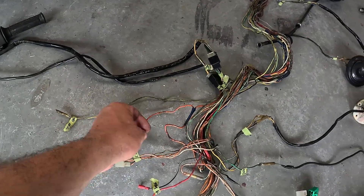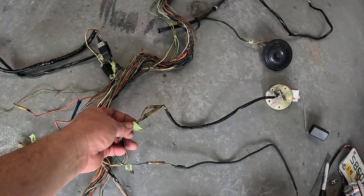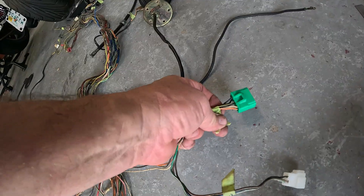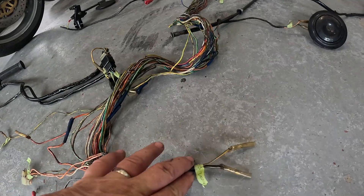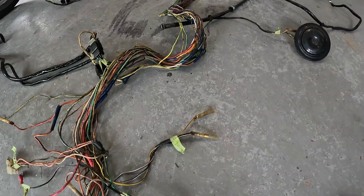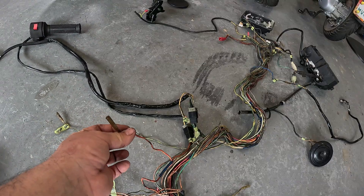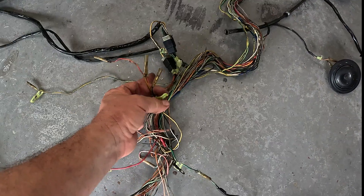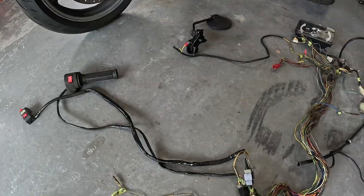As we go up the harness we're going to end up with wires we don't need — like the starter relay, coil wires, engine temperature sensor wire. But some stuff we're going to keep. For example, that orange wire going to the CDI box was a 12-volt constant source when the key was on — I can use that for LED lights, stereo, something like that. Universally, an orange wire is a good outlet — hot at 12 volts. Similarly, a black wire with a white stripe is usually your ground.